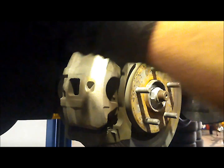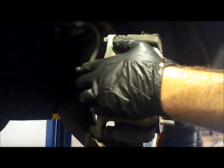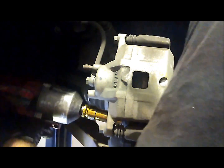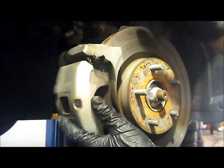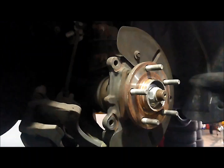There are other methods — this is just the way I can do it quickest. I'm figuring out the size; in my case they're 18 millimeter. I'm going to turn the wheel towards me to get some room to work, and use my impact — you may be using a ratchet. I'll drive out that bolt, then the same on the bottom one. I'm going to put the bolts someplace safe — they're both the same size, though some vehicles may be different, so pay attention. Then your rotor should just slide off.